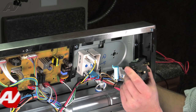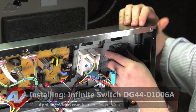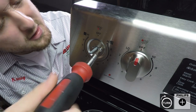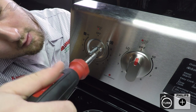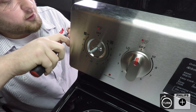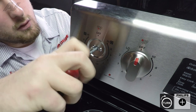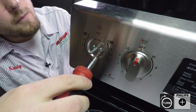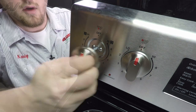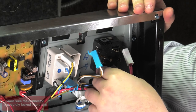When installing your switch, make sure that your lettering is correct when you're positioning it — this will put it in the correct way. Slide it in and match up where your screws go. Do not tighten the first one all the way so that you have room to wiggle the switch, then put in the secondary screw. Go ahead and replace your knob. Next, reinstall your molexes.